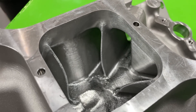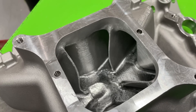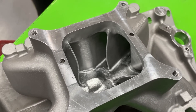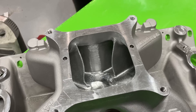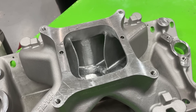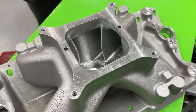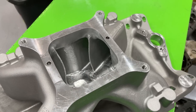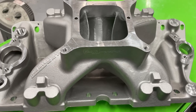The biggest thing was getting this side better and really the transition at the top. I also did the porting to match the intake opening — it's going on a 1206 with ported Profiler heads, so it'll be an interesting deal. The finished product: if you're thinking it's too smooth — that's 40 grit, so it's not entirely as smooth as you'd think. Do I think it's a great intake? It's probably pretty good, but it's not my favorite. If you have hood clearance and anything 400 cubic inches up wanting a 4150 carb flange, a 2892 ported is the ticket to me. Under 400 cubic inches there are several good options.